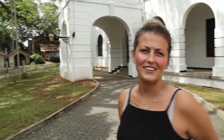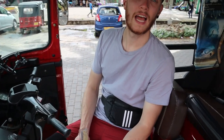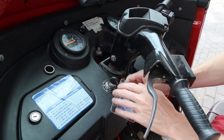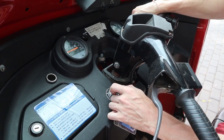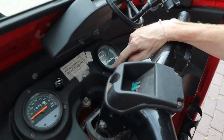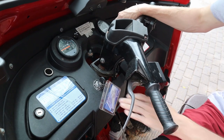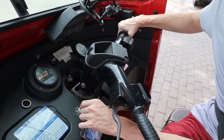Step one, you actually need a tuk-tuk. So this is how to start your tuk-tuk — grab your key, put it in the ignition down here. Turn it once, turn it twice, and now all your lights will come on under the dash. It will show you that you're in neutral — the green neutral light. So you're in neutral which is green, that's good. Then all you do is turn it to the right and give it a flick of gas.